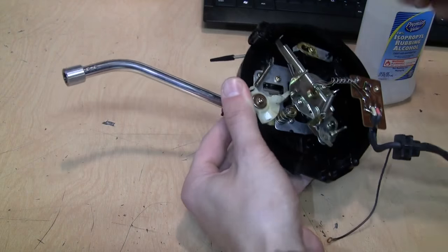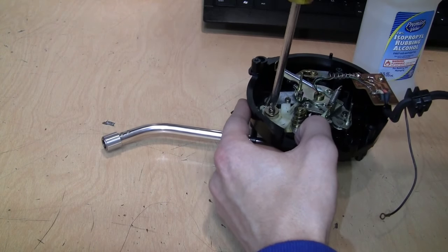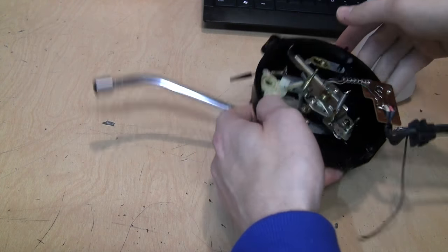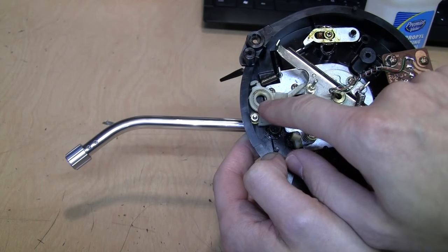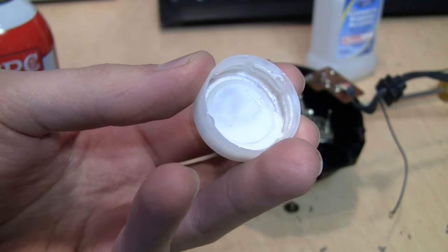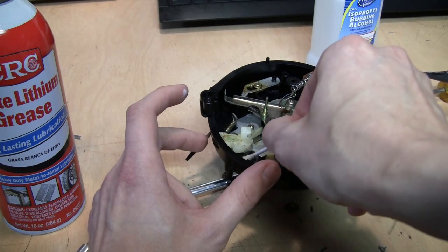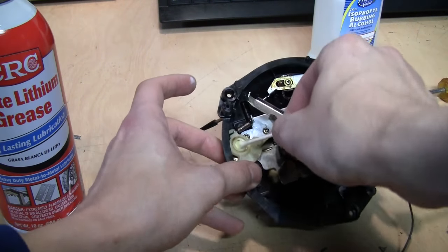Which is what I've already done. Then you can remove that little arm — just one screw there. Your fingers will get dirty but that's no big deal. Pop it off this little holder. This little post is the most important part — clean up the old grease, and clean out the hole in the arm that was mounted on that post. Then apply some new white lithium grease. I've sprayed some into a bottle cap so I can soak a cotton swab in it and lubricate around the post and most importantly inside the hole in the arm.